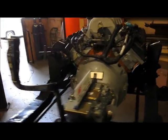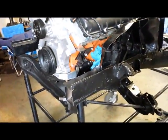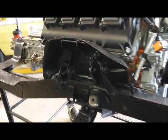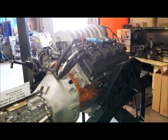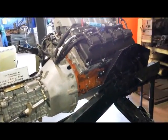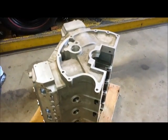That's because TTI spends a lot of time mocking up headers into fixtures. What we're looking at right here might look like a trade show display, but TTI actually has an A-body stub frame here, and they're able to take any engine mounted in this stub — with the front suspension — and work out and calculate all the header bends they need. Here we've got a Gen 3 Hemi being used to mock up some fitment issues, but this was also used for our particular engine. Speaking of our engine, this is the Indy Max block — it's aluminum and a bit different than your traditional low-deck wedge motor because there's a lot more beef in it.